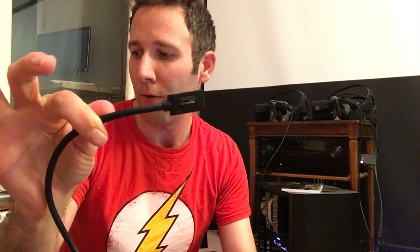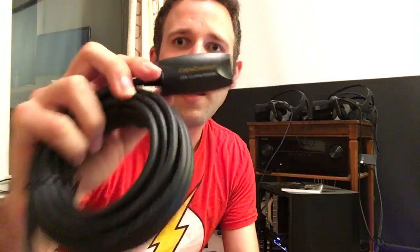Summary - the cables that always worked. Amazon Basics 1-metre passive extender works on all ports: AS Media, Intel, and Inateck. Cable Creation USB 3 5-metre extender works on all ports, every connection always detects as USB 3, and hasn't dropped in my experience. The Mutec 5-metre cable - I've tested this the most, it works on Intel, AS Media, and Inateck, and I've been using it for hours and it's never dropped out. It always detects as USB 3.